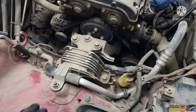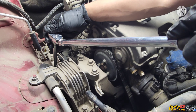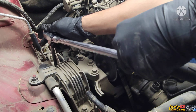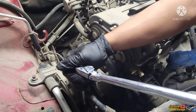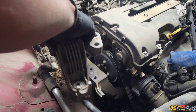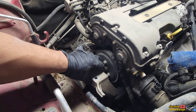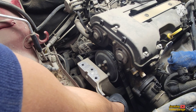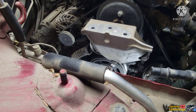Here's the setup — supporting the engine up high. We're going to start working to take out the engine mount on the right side. The socket you need to remove those bolts and one nut is a 15 millimeter socket; they're all the same. Just crack them loose and zip them off with the impact. There are three or four bolts down here that hold this mount to the block — take those off, also 15 millimeter.